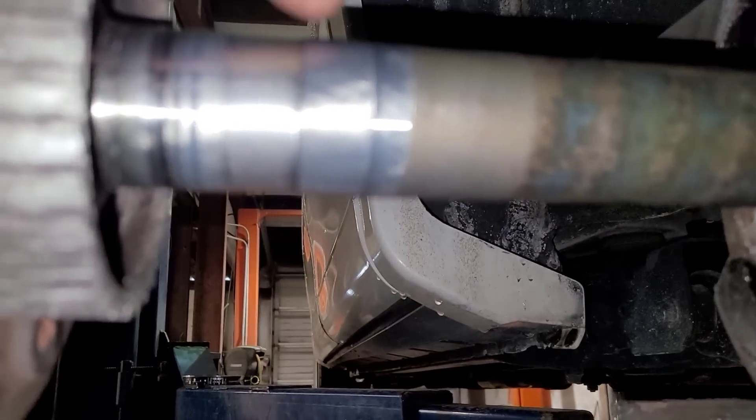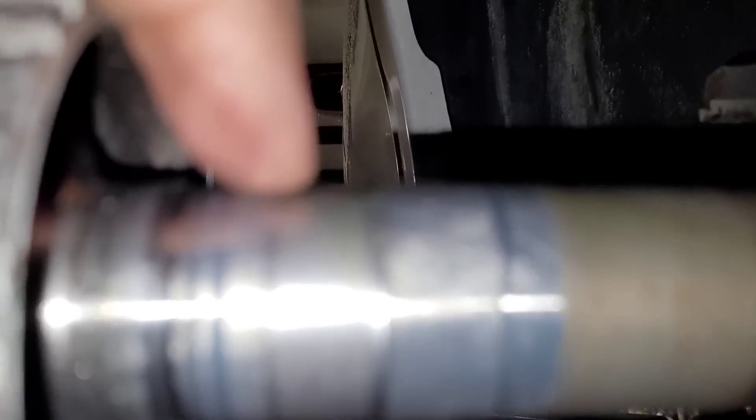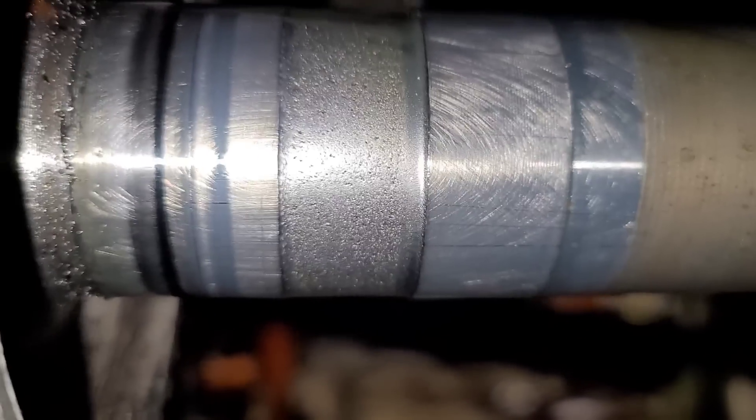I'm going to try smacking the axle in a little more. You would think by now from this thing bouncing back and forth that it would drop. Plan C. Sometimes you've got to investigate a little further. I didn't even think about it until just now, but the wheel stud — this is part of the parking brake mechanism — see it's hitting right there, so it can't go in even further. That should allow it to drop out. And there it is.